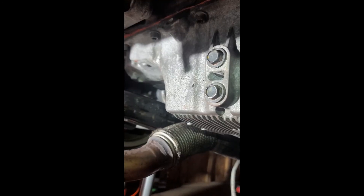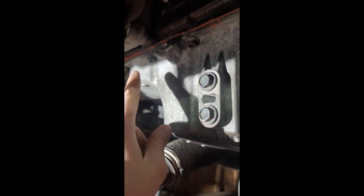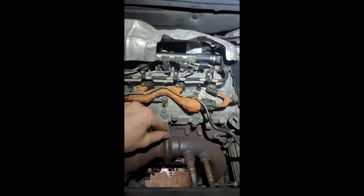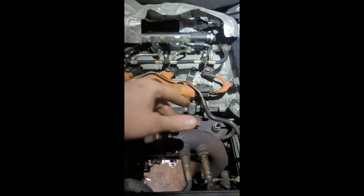That's going to conclude this video — it was a pain in the ass. Now that I've got the oil pan up, if you don't want to get any fresh sealant from around the oil pan on your new oil pump seal, disconnect your delete pipe. If you have a DPF you're kind of screwed, but go up top and disconnect either the heat shroud or, if you don't have a heat shroud, just that single connector right there and it'll loosen up.